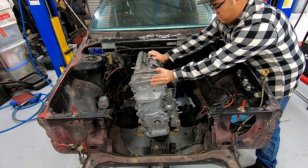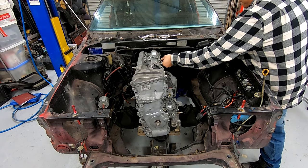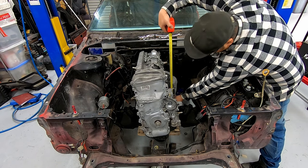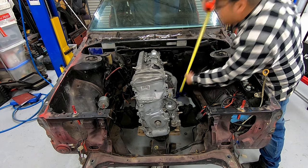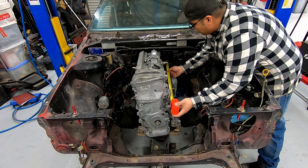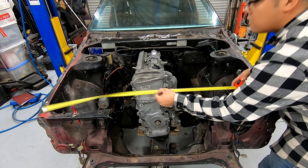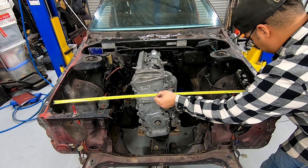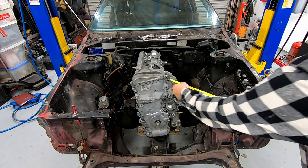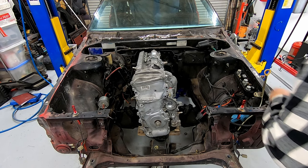You want to mount the engine as far back and as low as possible. We'd all love to have our engines JGTC style with the motor pretty much sitting next to you, but a lot of the time that just isn't possible without major mods to the firewall. As a rule of thumb, for a four-cylinder you want to aim for your strut towers to be in line with number two spark plug — meaning if you draw a line between the two strut towers it should intersect with cylinder number two. This will keep your center of gravity closer to the center of the car.